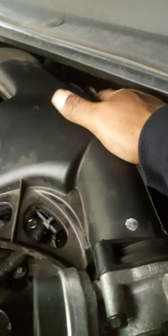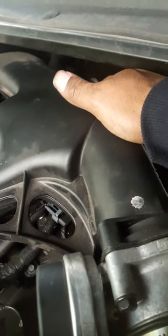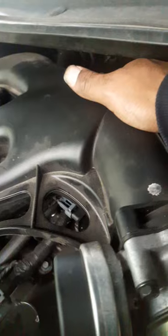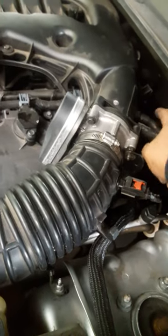It's because I had the EGR valve — which is this back here — I had the gasket showing on it, so I had to push it up a little bit. Sort of hit the hump. I did put it in so the vacuum seals and stops the shaking. Hook up all your hoses — you got a hose right here, hose right here, and a hose right here.